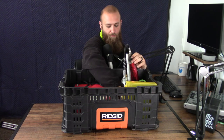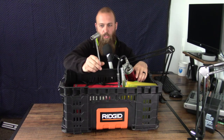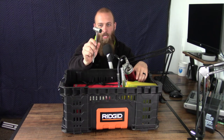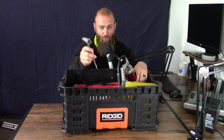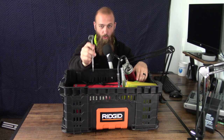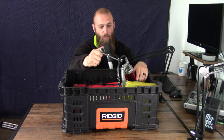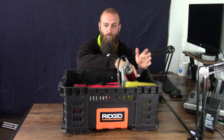I have this tool — I'm not quite sure what it's called, but you get it with every chainsaw and other kinds of equipment. I've been calling it a 'scrunch' — it's a screwdriver and a wrench on top. It's been good for spark plugs, like you'd use on a chainsaw. I've used this a couple times to do a tune-up on the fly on my blower. One day my blower wasn't working right, so I swung by a store, got a tune-up kit, and fixed it up brand new in the parking lot — took all of five minutes. Air filter, spark plug — you get the idea.